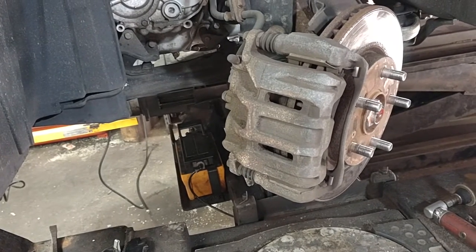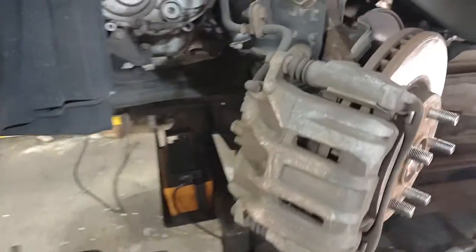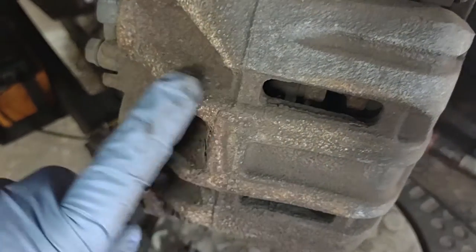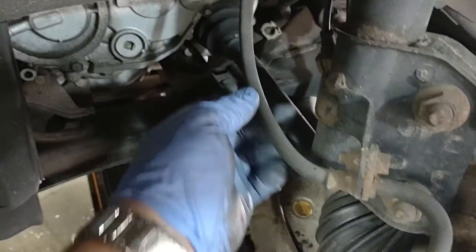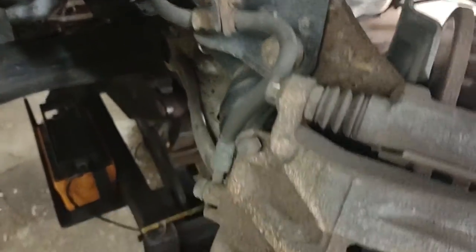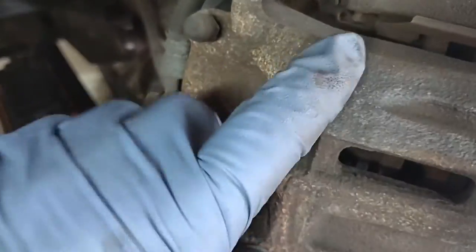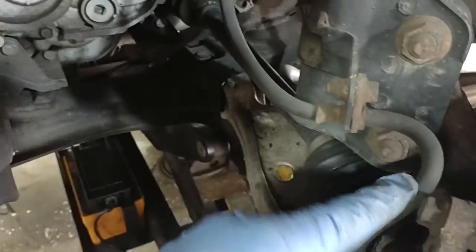The right way to do it is to inspect everything — all components that have to do with the brake pads. You need to inspect the caliper; when you retract the piston it has to retract nice and easy. Make sure this hose here is not clogged up. If the piston doesn't go back easy or there's too much force to bring it back, it could be the piston frozen inside the caliper or the hose itself is clogged up.